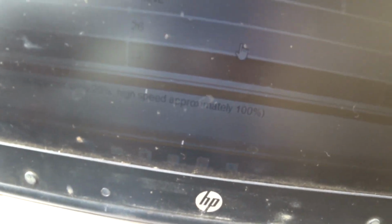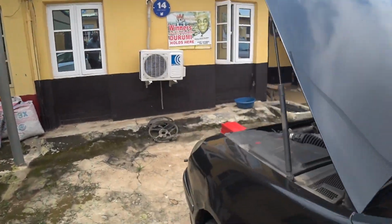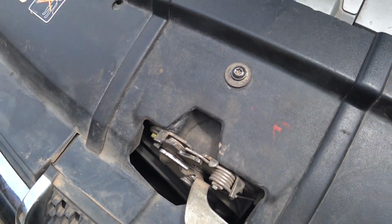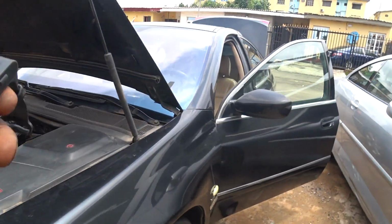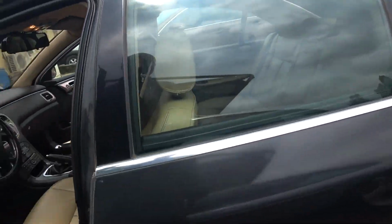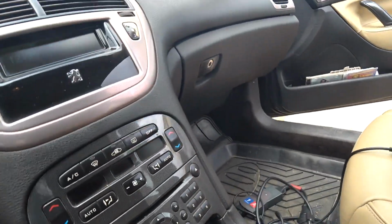Okay, so the fan comes up at 98 coolant temperature. So you can see cooling fan speed 22%. So let's look at the fan now. You can see how smooth, you're not getting any spark from the fan now. So the low speed is working on this one, compared to the other one, which I tested both on AC and without AC, and it maintained high speed.